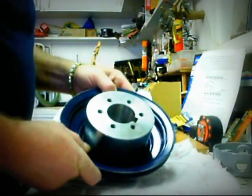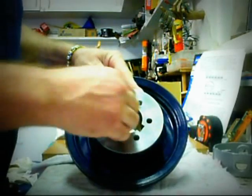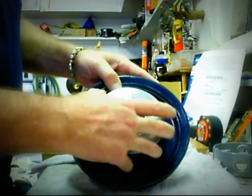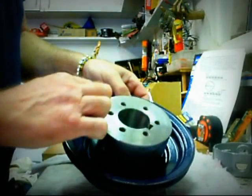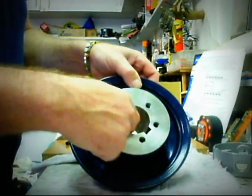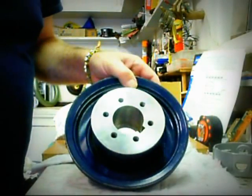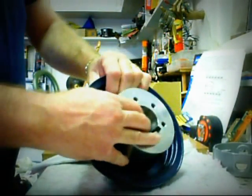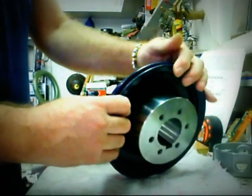This here is the collar that will fit over the motor shaft or spindle. This collar is four and a half inches in diameter. The inside diameter is one inch and seven eighths, large enough to fit over the shaft of the motor. And on this side I just put a pulley array.